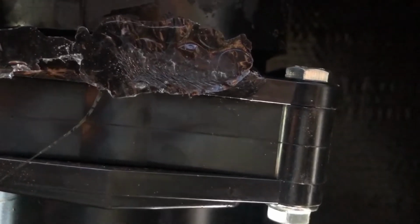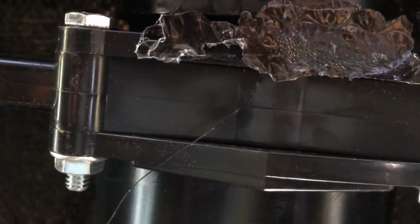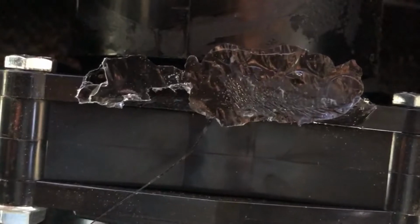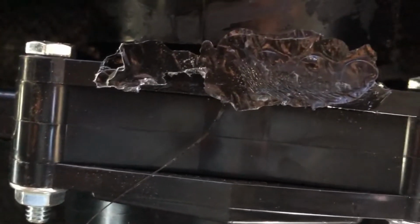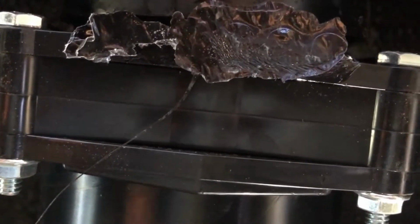Also, if you're loosening this, I've got my valve closed right now. I have this all the way closed, but just keep in mind, if you take these bolts off, this will leak some. They say it's best to do this when your tank is dried out, but I don't have that luxury. I've drained the tank, but it's not dry. So you'll probably want to put a bucket under here, and since this is the black tank, you don't want to be underneath it. As soon as you start loosening this, it will probably leak a little bit, okay? So just keep that in mind.